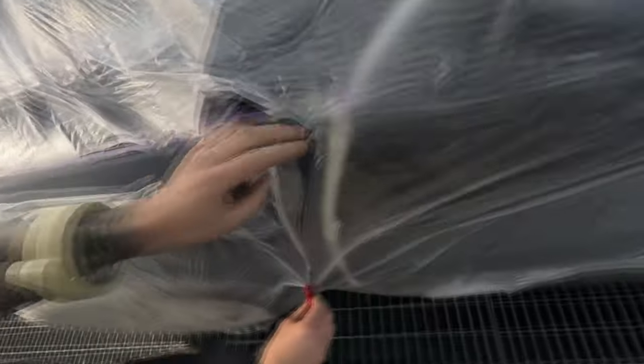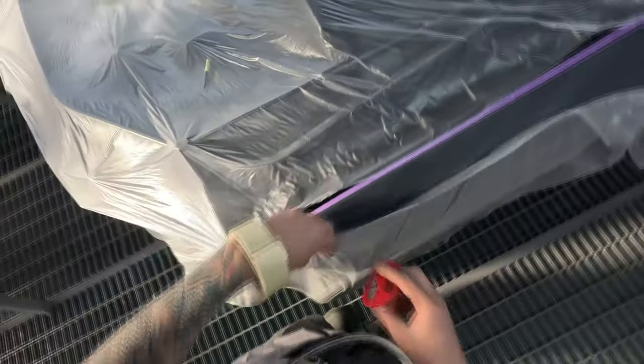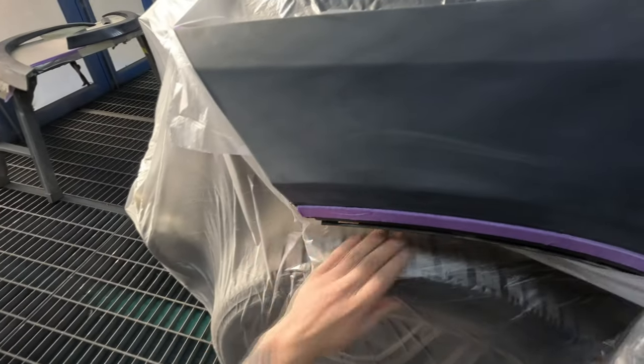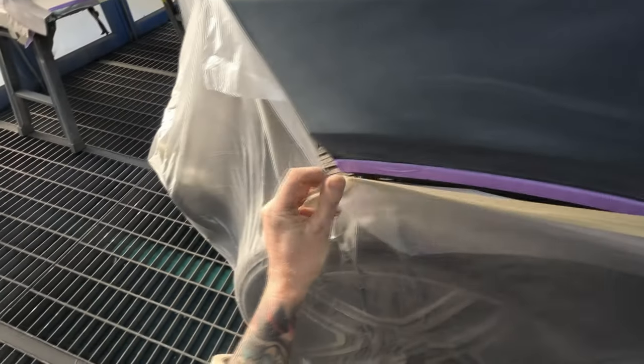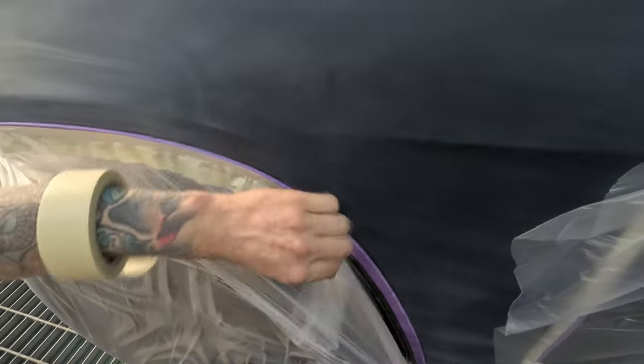But the way to fix it is to use the slow blender but put less on, if you know what I mean. When you put the base coat blender on, you need it to stay wet while you're doing your blend. So if you're using the normal blender, sometimes you can be tempted to put it on a little bit heavier to stop it from drying too fast. That's basically why, when I called up the paint rep, he said use the slow blender all year round.